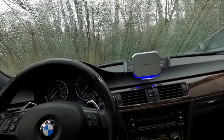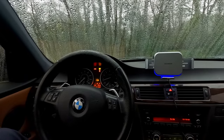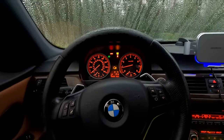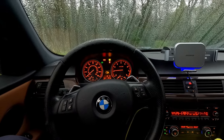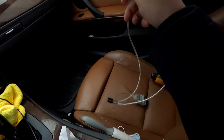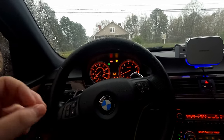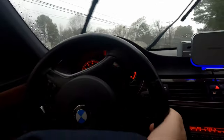Guys, it's freezing — pollen season hit hard but the rain is clearing everything out. Right now it's raining outside so I'm not gonna push it. I'm gonna go maybe quarter throttle and show you the shifts in D mode, sport mode, and manual mode, then after I tune it I'll do it again. You need to let the transmission adapt to the new tune — after 50 miles is when you start pushing it. Got my DCAN cable here, I'll leave the link in the description for both Samsung and iPhone.